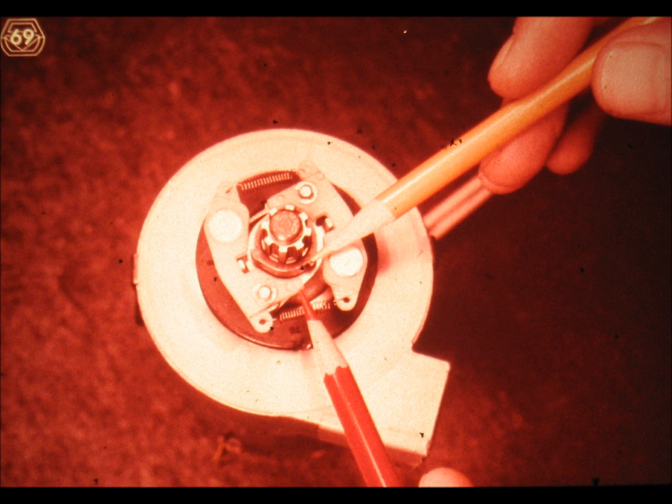Notice the motor clutch pawls and the weights attached to them. The RPM of the motor must first reach a minimum level before the weights attached to the end of the pawls will tend to swing out against the action of the springs connected to the end of the pawls. As a result of this, one of the heels of the pawls will engage with one of the teeth on the motor pulley.